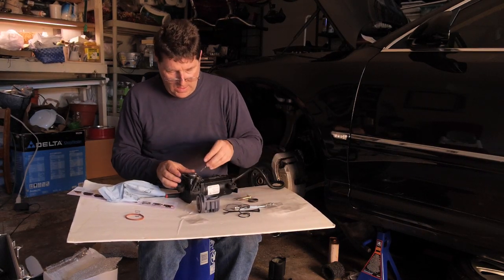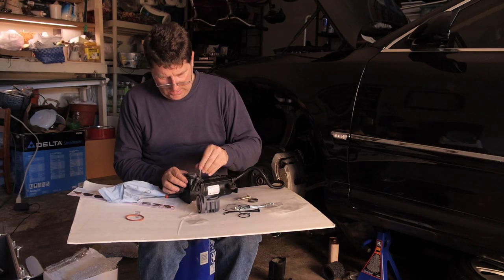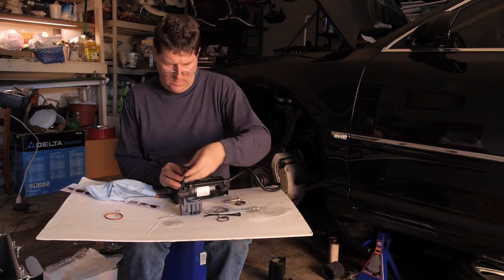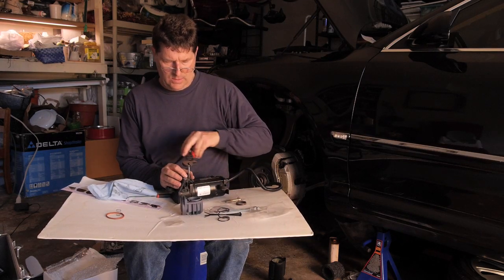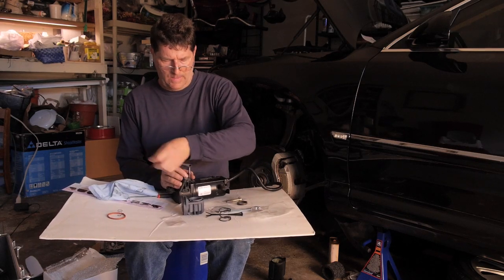Okay, so let's go ahead and use our tap and make sure that these holes are clean. That's in here. So go in a little bit, go back a little bit, go in a little bit more, come back a little bit, and we'll just work our way in there.